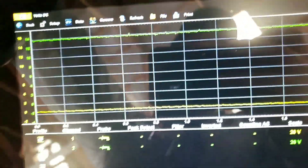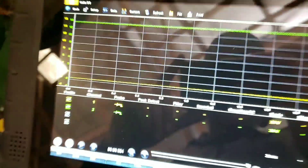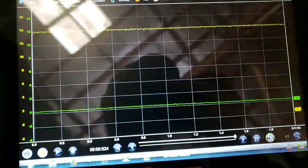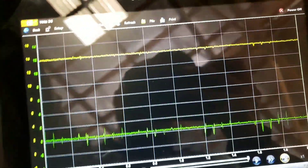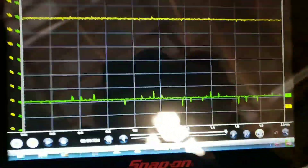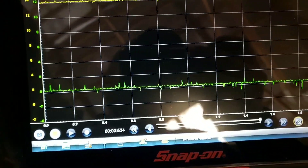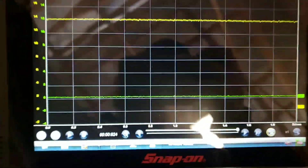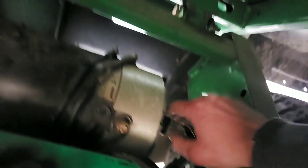Let's check it back at the speed sensor. We are probed in back at the speed sensor on the sensor side, not the main harness side — same deal. Forward — and reverse again — whole lot of nothing. Needs a wheel speed sensor, or motor speed sensor — same thing as a wheel speed sensor, it just toggles a zero to five volt square wave. Nothing we haven't seen a million times before.